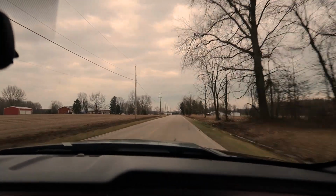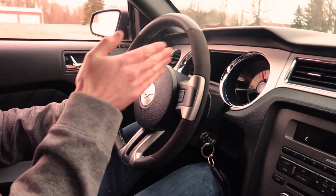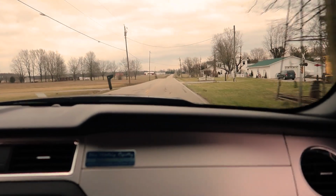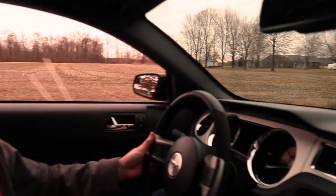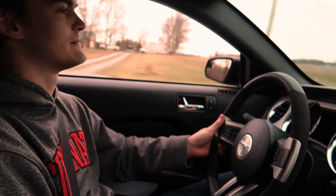How's the wheel at this speed? Not good, it's going like that. Is it? The whole car is just kind of going like that, wandering around right now. It's a little far off. When I'm cruising though, it seems okay. It just kind of wants to wander. Like if there's a bump in the road, it's just kind of tracking that way a little.